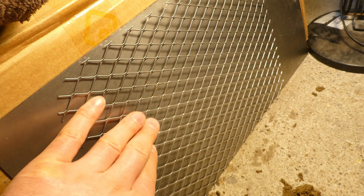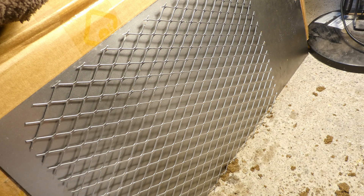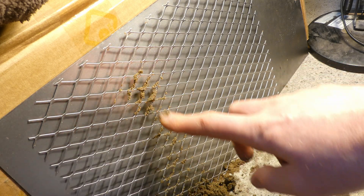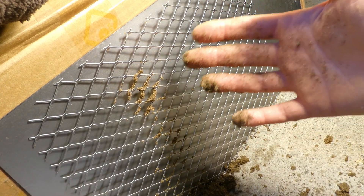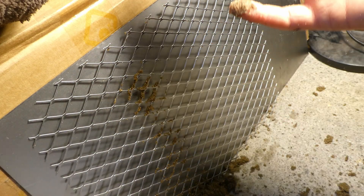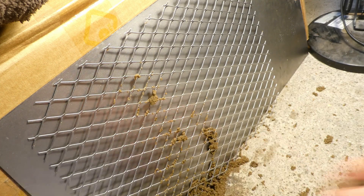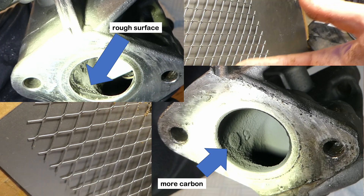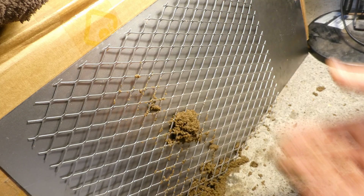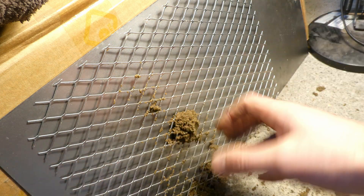There are small holes that you cannot see with the naked eye, but they are still there. You still get carbon from the engine going through the EGR, but this time the carbon sticks quite a bit. These bits will act as seeds for more and more carbon particles to stick to the surface of the EGR. The rougher the surfaces, the more carbon particles will attach to it — just like this barbecue grill. In other words, your EGR valve will much more quickly become clogged.